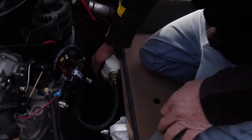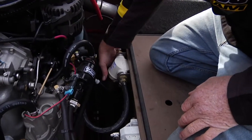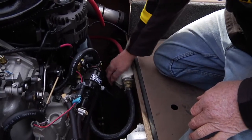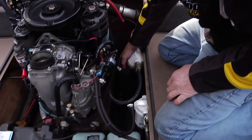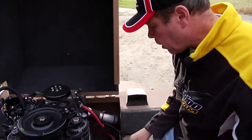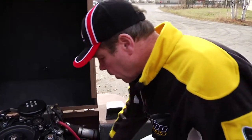If you have a sand trap, you want to drain the glass bowl on the sand trap, then screw it back on snugly. Make sure that's empty. If you leave it full of water and it freezes over the winter, it will crack. If you don't lift your engine and check in the spring, you'll fill the bilge with water and the boat will get very heavy in the back after about 10 minutes.